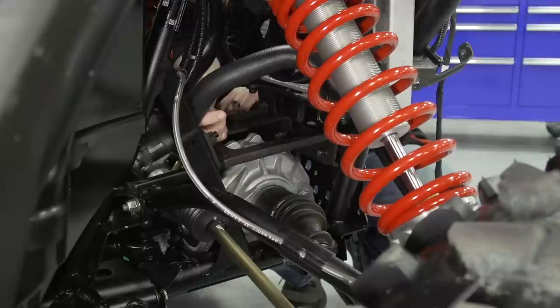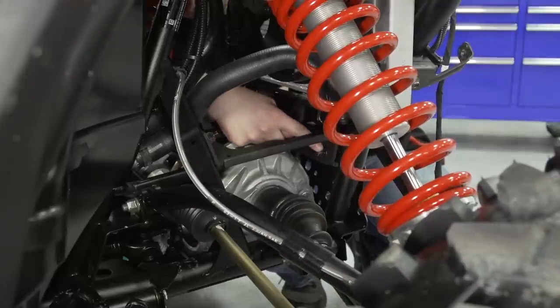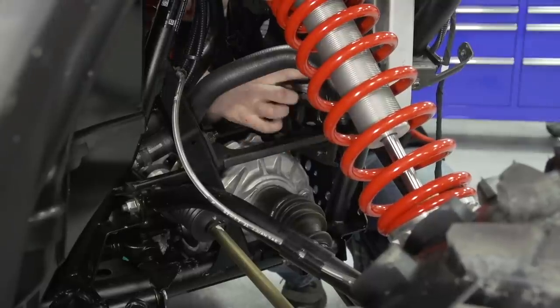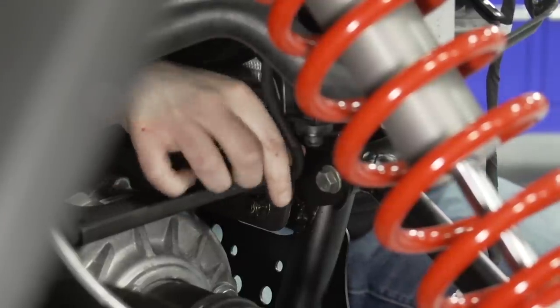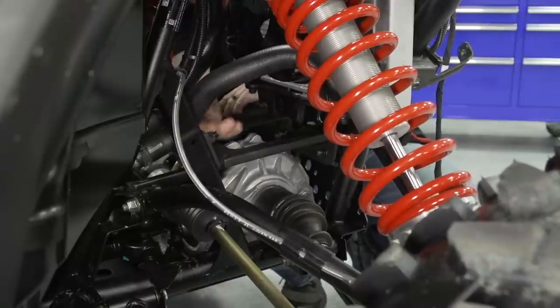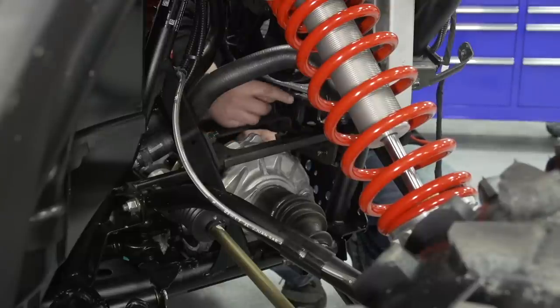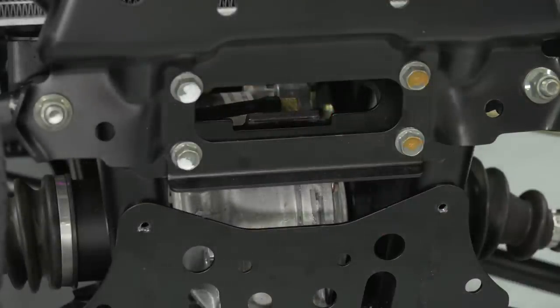Those bolts are carriage bolts with nylon lock nuts. The rear bolts go from the back side through the frame, with the nuts on the inside. The front bolts come from the front of the vehicle with nuts on the inside nearest the front gear case. Note: there's a vent line here — the atmospheric vent going to the front gear case — and there's a notch cutout in the mounting bracket that needs to be in place. Make sure coolant line hoses aren't pinched by the bracket. The lip of the bracket in the back rests on the frame, and there's another tab on the front that also rests on the frame. Torque everything to specification.